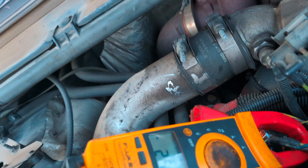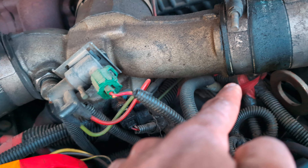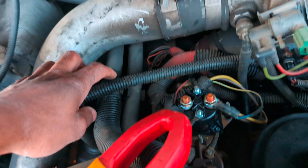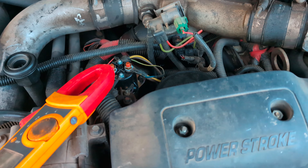Our amp meter cut off but we've only got about 25 amps or so total — that makes sense where we had about 14-15 over on the driver's side and then maybe about 5 amps over on the passenger side. So with that being said, I would probably pull it down — it's probably going to need glow plugs. This truck at about 35 degrees should be pulling initially close to 120-150 amps on the initial key-on, and it shouldn't be that low side to side — if there's only 5 amps going to that bank you figure 5 amps divided by 4 glow plugs, that's essentially just over 1 amp per glow plug.